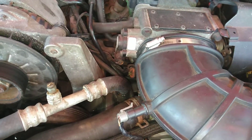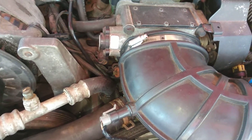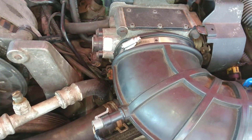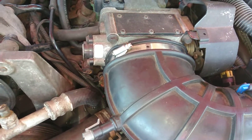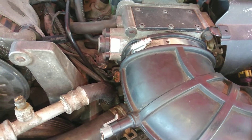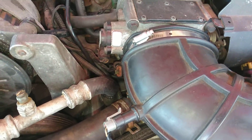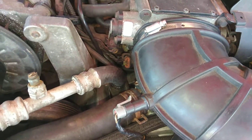That'll probably give you 2 or 3 horsepower because you want cooler, denser air — that's the name of the game here. The coolant gets hot as it's running and you don't want that heat in there with the throttle body. So that'll give you a little bit better, cooler, denser air — probably not enough to feel, but you will notice a difference.